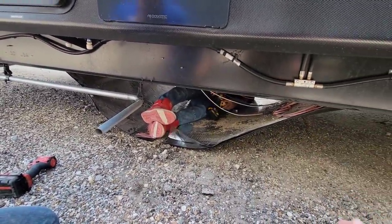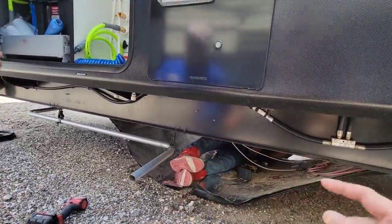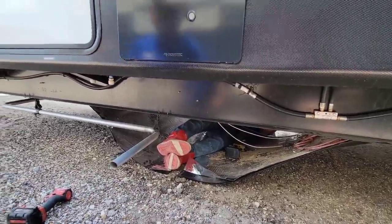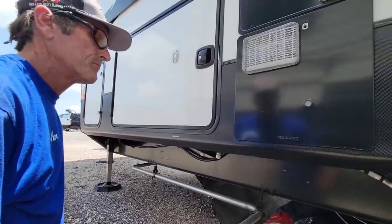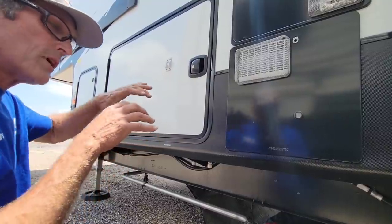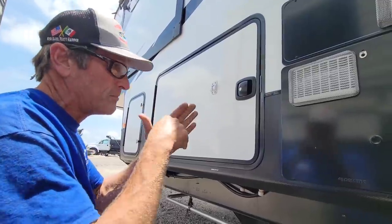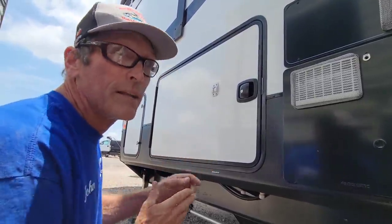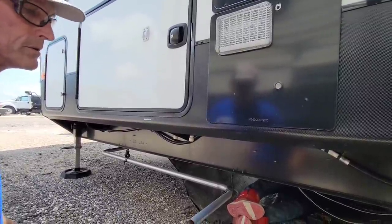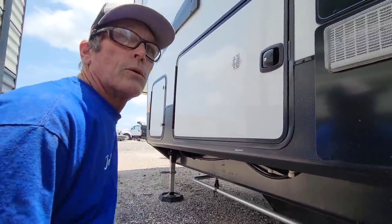It's actually been like that since the day we got the RV. I had noticed that lever didn't push in or pull out all the way. The technician thinks the seal might be the issue — there are rubber gaskets that go around it, and if you don't get those right back together perfectly, it's not going to slide in and won't slide to the middle. So the valve may not be bad — it actually could have damaged the seal. It's like a little plastic blade that shuts, and it could have cut the seal or damaged it.